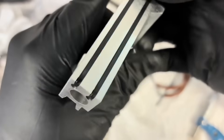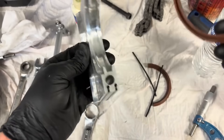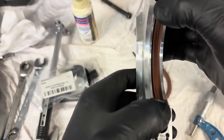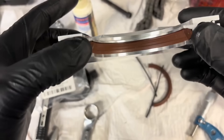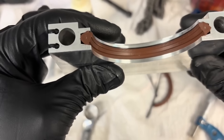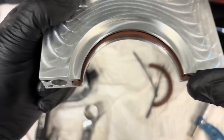You don't have to wear black gloves — I just wore them because I'm about to be touching a lot of ARP lube, and I don't like it all over my hands. Drop our seal in — brand new seal. That's the front of the engine. I don't have to put anything behind the seal. It does stick out of the cap just slightly on both sides. We're not offsetting the seal or any of that crazy madness. I'll put a dab of sealant on each corner when it goes in. Also lubing the outside of the seal — the lip is facing forward so the oil will blow into it and not get out of the engine.